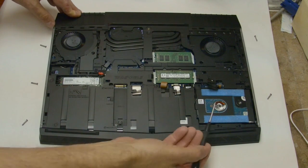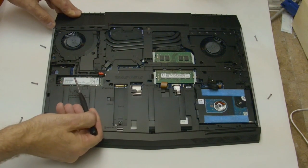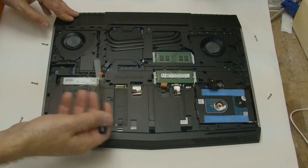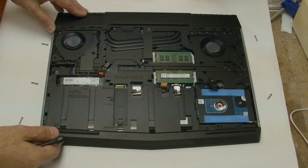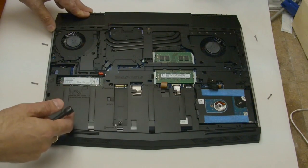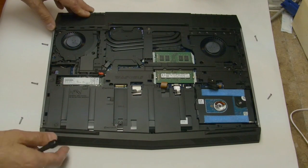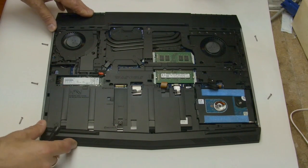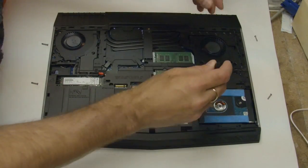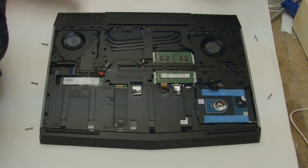I've cloned the hard drive to the SSD, but the BIOS won't let me choose which drive to boot from. What I like to do is take out the original drive and boot from the cloned drive to make sure it all works before erasing the original — otherwise that would really suck if it didn't work.